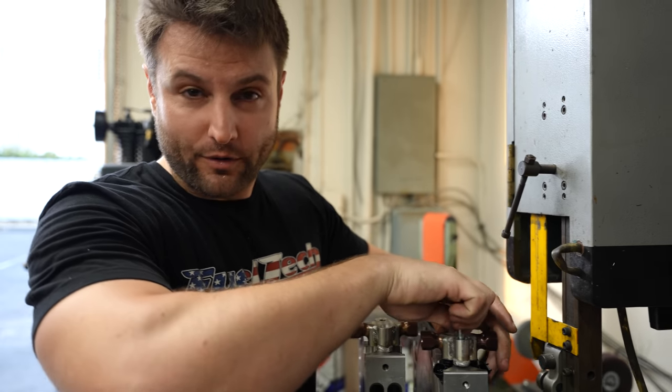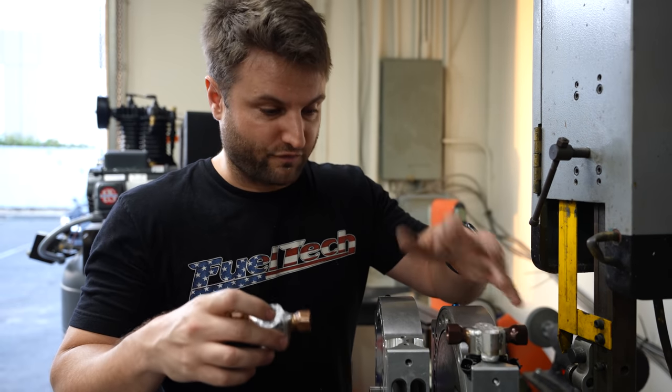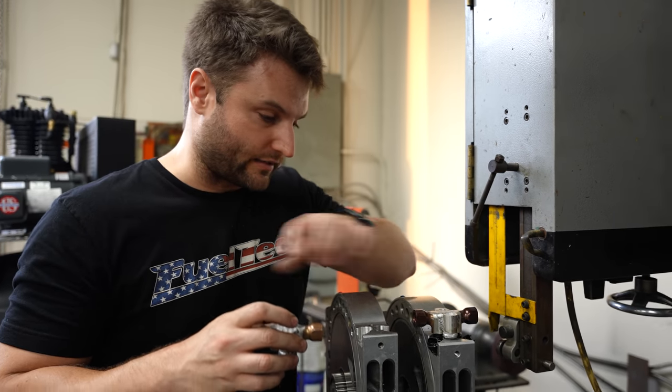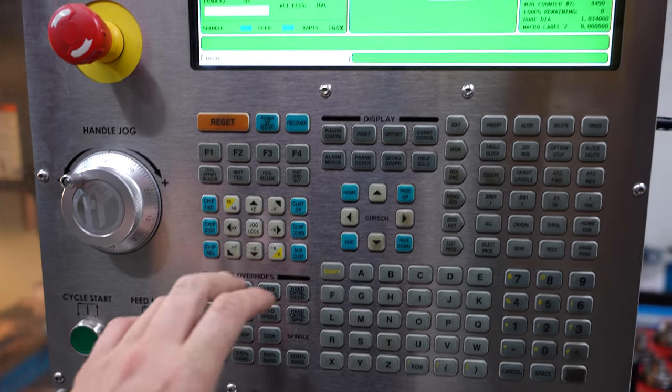The point of these is to not think about the fuel system at all. We'll actually have these so far apart and weld a tube together, so it'll be one fuel rail — firm, thick — and you just don't have to think about it. This end you can visually inspect, and this end you can visually inspect, and you don't have to worry about fuel popping out. I had to finish the fuel rail. I've got a chunk of aluminum scrap in the shop that is perfect for this. We're going ahead and just doing the first rough cut and I'm going to speed through it.